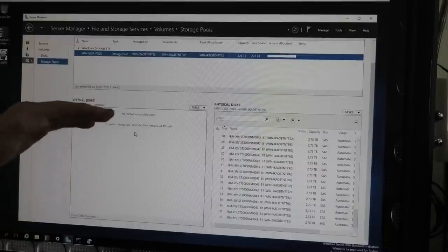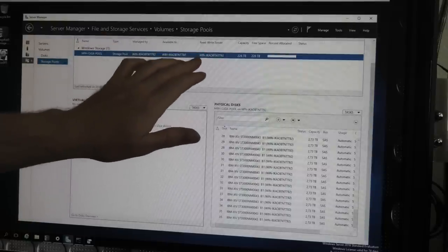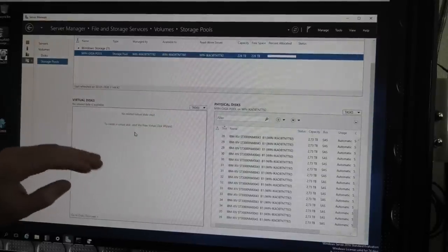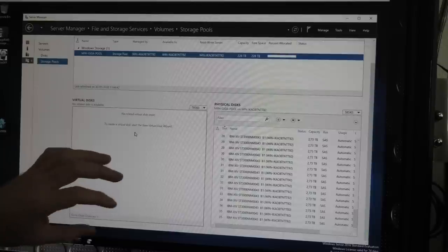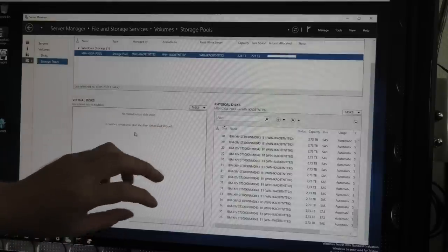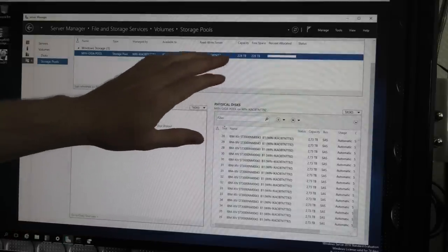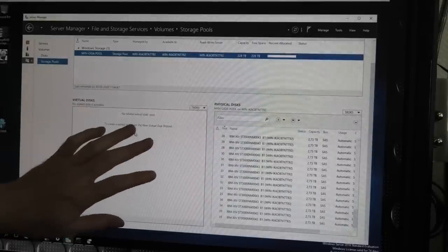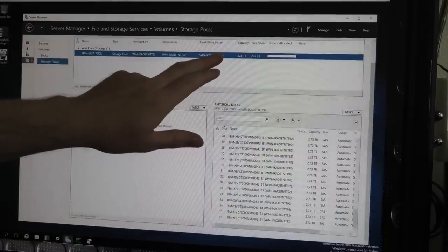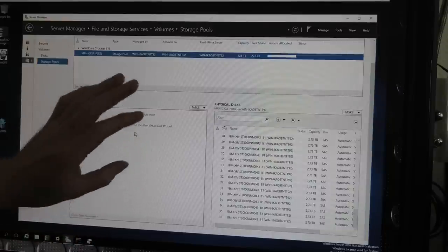And I can have a lot of virtual drives that all take a bit of space off from the physical drives. And I can actually also over-provision that. So I can have 2 drives of 500 terabytes. I don't know, I haven't checked if that is possible, but over-provision that. And sure, they're not 500 terabytes, but they will use up this space until there is no more, which is of course a bit dangerous, but it's doable.